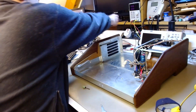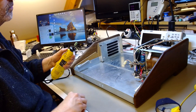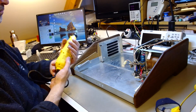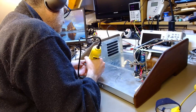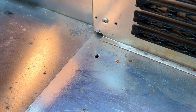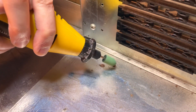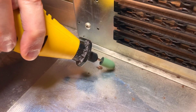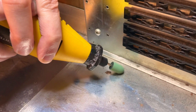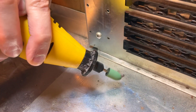That's a very hard rubber and I need to remove the superficial rust — not the pitting, but the superficial rust. It can remove without damaging or scratching the metal. It will change the way the metal reflects light so you'll be able to see where I did the work, but it doesn't remove any metal. Look at that little spot there. Most of that rust is superficial, so if I just gently go over it with this rotating rubber tip, most of the rust goes away. You can see there is an area of deeper pitting that remains.